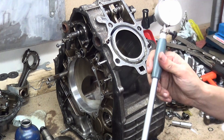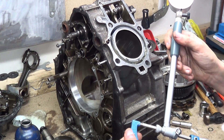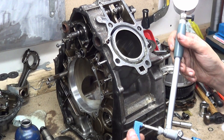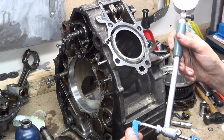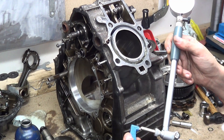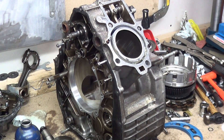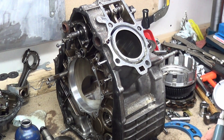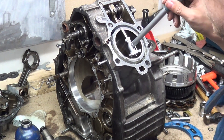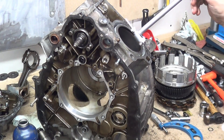Don't ever trust these because they're rubbish, even the really good ones — you have to use a micrometer to measure the clearance on the end. So what we're running at right now is around about 171... 78 and nearly a half. So 78 and a half, and the service limit is 78.1. So we should get a reading in, and if I turn it this way you can kind of see what I'm doing.